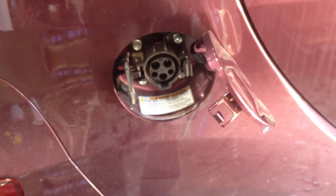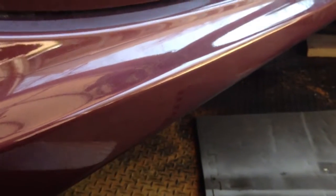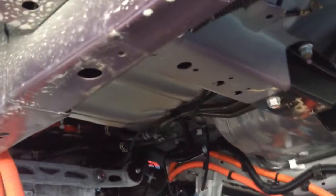Let's go under the car. People were wondering if any parts are aluminum, so I've got a powerful magnet here. Testing the body — it's not magnetic at all over here, that's fiberglass. But underneath the car it's a traditional steel body — the magnet sticks right to it. This is all typical steel construction; I didn't see anything aluminum.